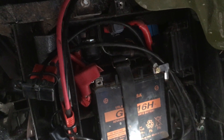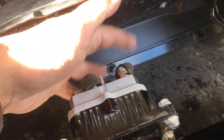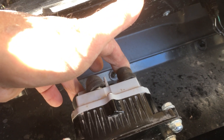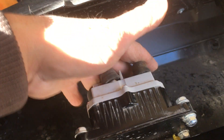The winch isn't working. Check your own work — make sure you did it right. Came forward, the controls work when the engine's running. Between red and black I have 12 volts. Between yellow and blue, even when nothing's being commanded, I got 12 volts. That tells me I've got power going to the motor and the motor should be turning, but it's not.